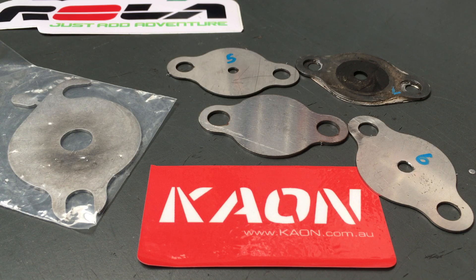If the EGR system is operating normally, 7mm works. There are people with 5mm or 6mm but I'm not going to recommend those — you're more likely to have issues. With 7mm we know for a fact it works. People ask if the intake stays clean: yes, look at the videos — the EGR valve stays alloy in colour. Again, work out the legalities for yourself.